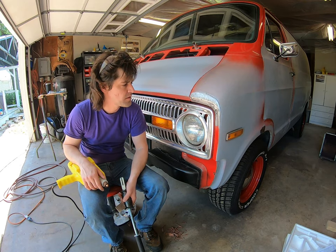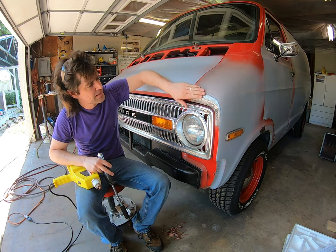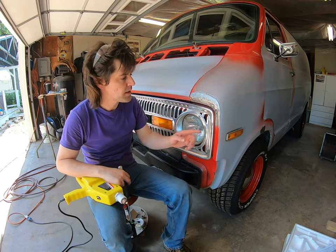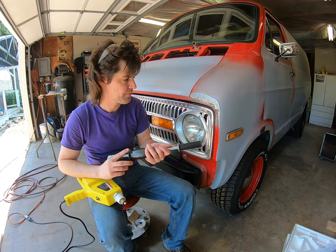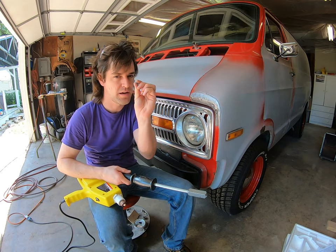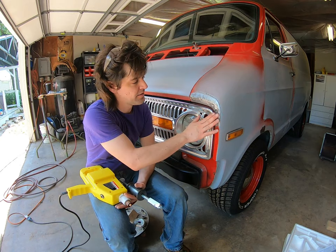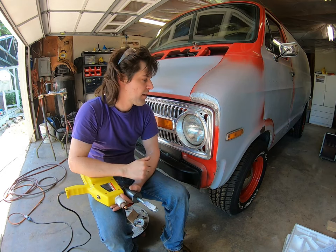I think we got this in a pretty good place. It's not perfect, and I'm sure some people could do a lot better — my body guys in particular. I've got most of this pulled out here within reason. This was the worst part right here where it was really bashed in, and it's still rough in spots. When I put some of the studs on there, there's so much tension that it'll either pucker directly out almost like a little pimple and doesn't bring everything out. But right here it did come true — it was way in, came way out, and it actually leveled a lot of that back to where it should be.